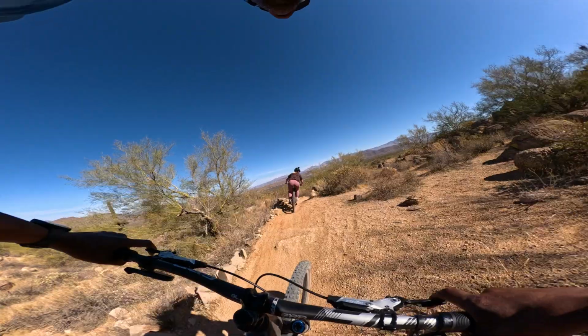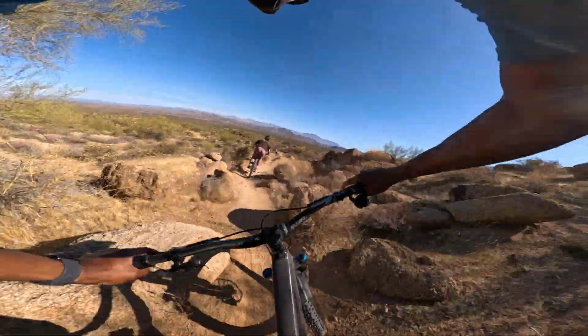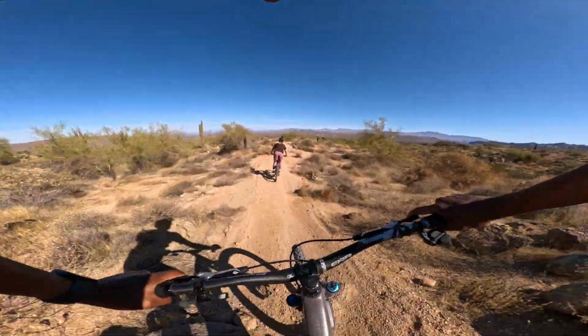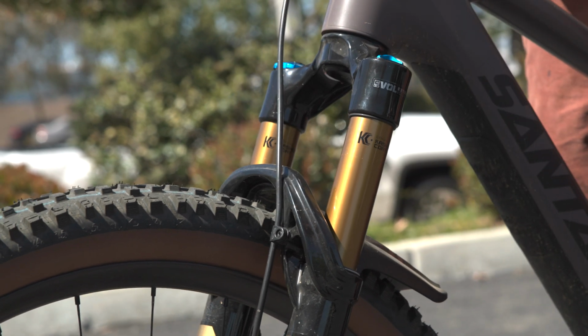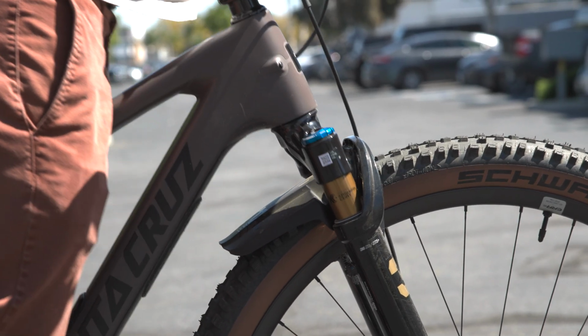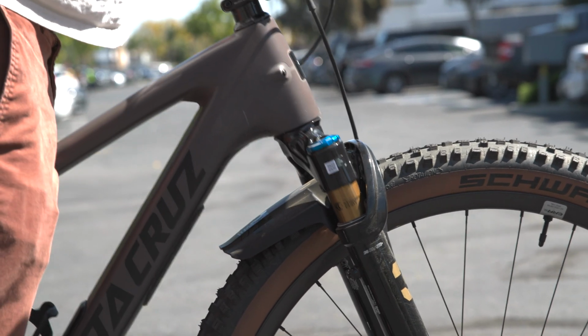There's always some bending going on in anything, a frame and a bike. As you're loading things, there's movement, right? Yeah. It's not as rigid as you may think it is. We found through studying that as some of these loads come into the fork, you start to bind up the air spring assembly a little bit, and that actually makes it harder for the fork to move, which is what we want the fork to do, to move freely when it's supposed to. So we made the air spring compliant, so the shaft that drives the air piston isn't constrained and can move independently of the rest of the chassis of the fork. In doing so, we found that the fork felt like it rode a ton smoother. It just felt more frictionless, more bottomless, like everything was doing what it was supposed to be doing more. And it's noticeable when you ride the forks. It's pretty impressive. But that's the whole idea of the compliant air spring.